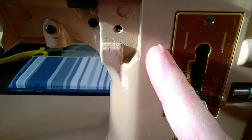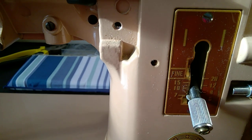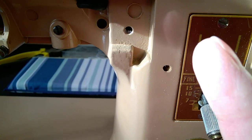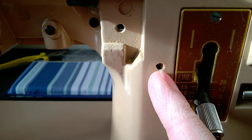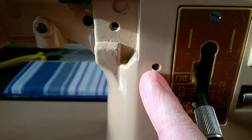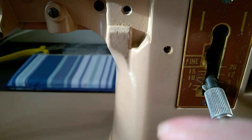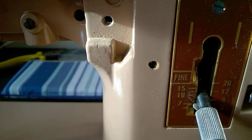And my sleeve here started to grab while the machine is spinning. So this is a very important point that is really common, I think, on these machines. That's why my recommendation is to use, actually, if you can, engine oil instead of that sewing machine lubrication oil, because the sewing machine oil is very, very thin. It's a lubricant, but it's not a good lubricant when there is wear on the metal.